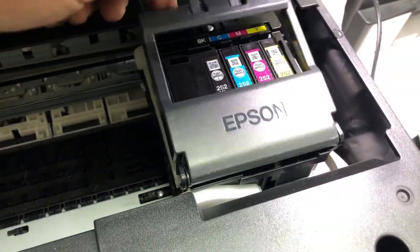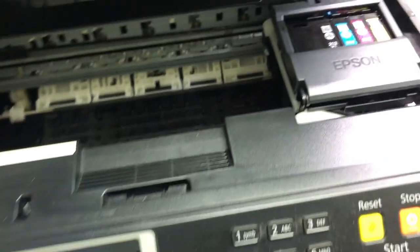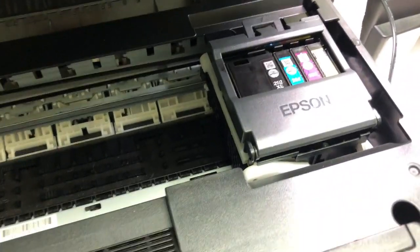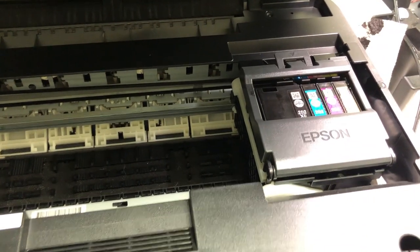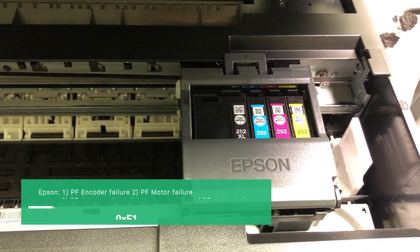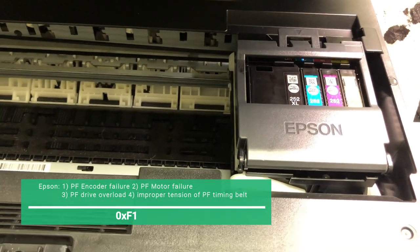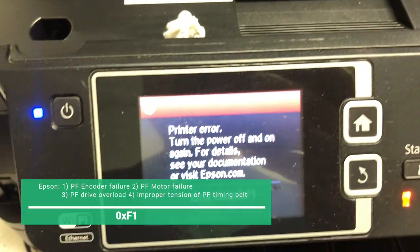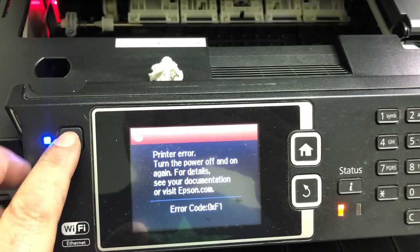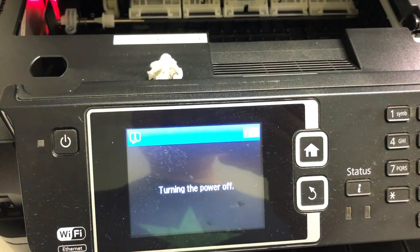The whole thing depends on where the printer gets stopped. Let me open the cover so the printer gets stuck at a different location. Right now it's trying to move to the right and gets stopped by the cover. You can see the error code is 0xF1. I'm just using the cover as a tool — your problem might not be the cover. The whole thing is between the belt and the mechanism stopping the printer at different locations.